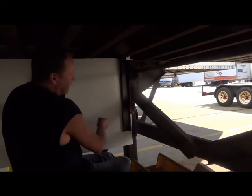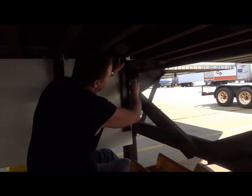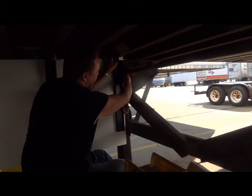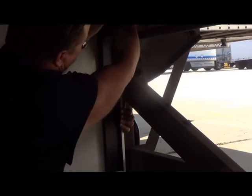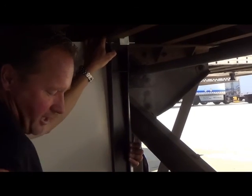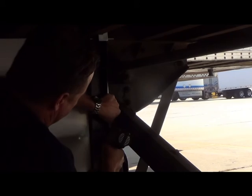on the trailer. The reason that I told you earlier that you needed a universal joint is sometimes the gearbox for the landing gear is right in front of here. This trailer happens to have the gearbox on the outside of the gusset. But sometimes finagling around in here doing different things, especially attaching the stanchions, is where that universal joint comes in handy. I'm going to go ahead and just screw on the last stanchion, just like all the others.